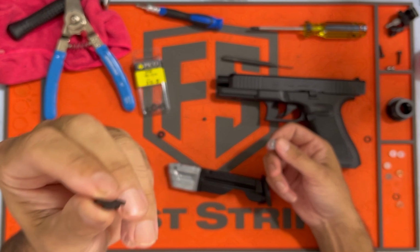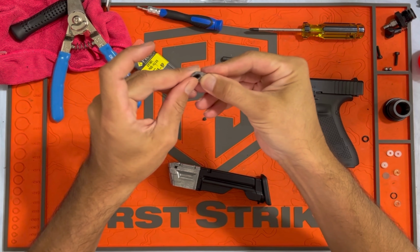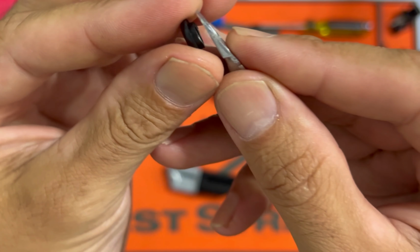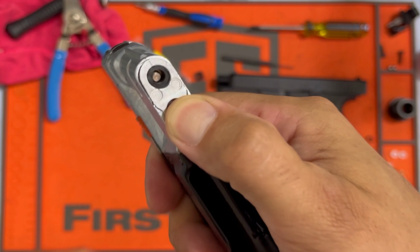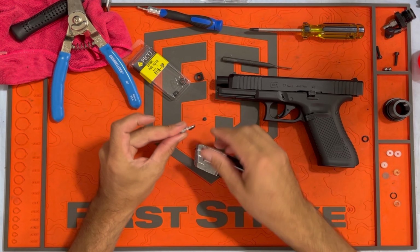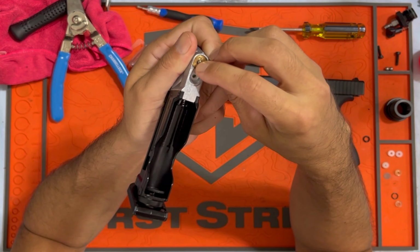So if this seal gets buggered up, a 3/16 vinyl grommet, I got this in Canada at a Lordco auto parts store. I cut the grommet in half and I used the long side, I guess you could call it. And it fits perfectly in there. And it fits back on there. And look at that. That's awesome. Yeah, it's up right now because the screw's not in there. Worked well. But again, that's not what I'm trying to do. It was to find a factory replacement. I'm trying to find a replacement that's going to be tighter on there.